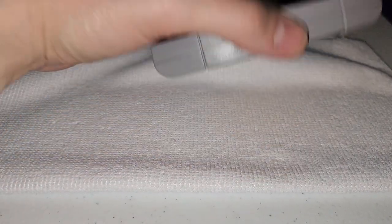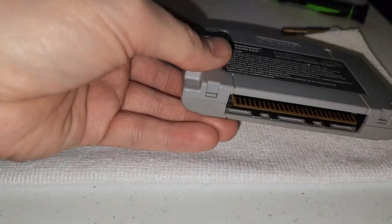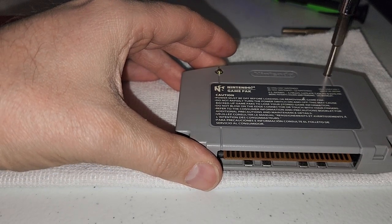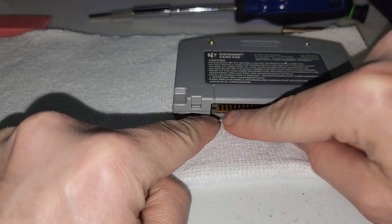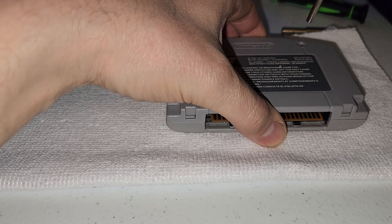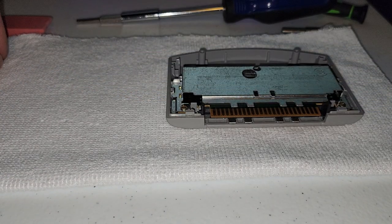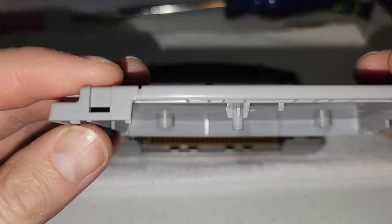I only use these when I take the screws out — when I tighten them, I hand-tighten so I don't strip them. To get the cartridge apart, there are two screws on the back. You just take those off, the top lifts up, and there are two little tabs on the bottom. You may have to lift up a little to get the screws all the way out. Put the screws off to the side. When you have it apart, if you have a lot of dirt in there, you may want to clean that — this one looks fine.